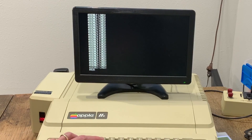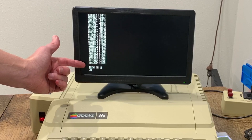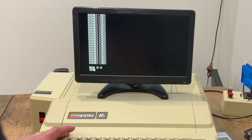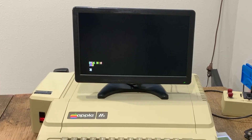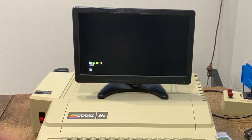Running the same program again — it looks really sharp. So for just an off-the-shelf LCD like this with composite input, it's doing an excellent job at handling the Apple IIe's strange video signal. Switching to graphics mode, it picked up literally instantly. You can see there's the usual color fringing on the text, and it looks a little bit more pronounced here on this monitor compared to a CRT from back in the day.